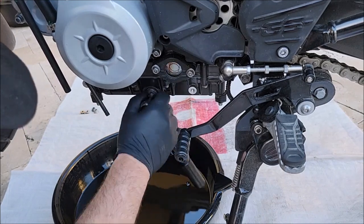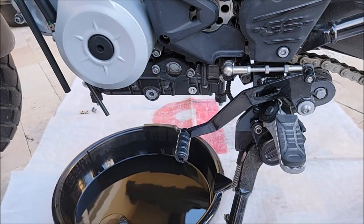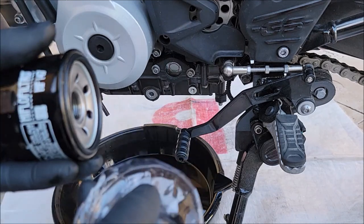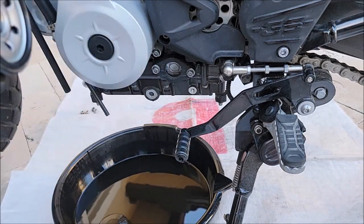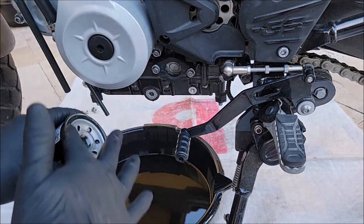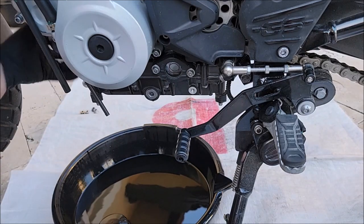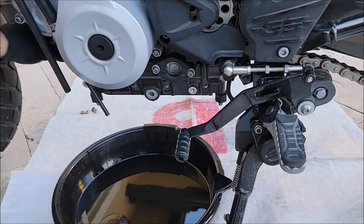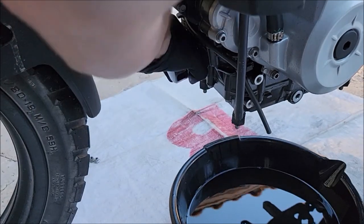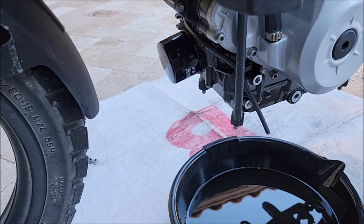I used a high-flow Filtro HF 147. It had plastic on it and was already pre-lubed, but I took my finger and put a little bit more oil on it — this prevents it from leaking around the seal. You can torque this down to 11 Newton meters or 8 foot-pounds. I actually did it by hand since I had a pretty good grip, and I had no leaks after a 30-minute drive.